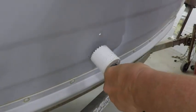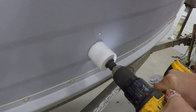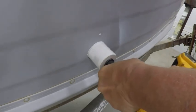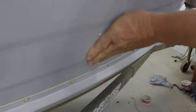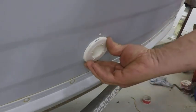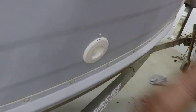Scary part — take your time. Don't try to force the bit through it; let the bit do the work. There we go — big old hole in the side of the boat. Now we slap this right in here, just like that. It's going to work out nice. The way the water comes out of the overflow, it will just run right out. I'll go ahead and stick this 3/16 rivet back in there and we'll be good to go.